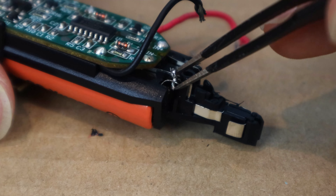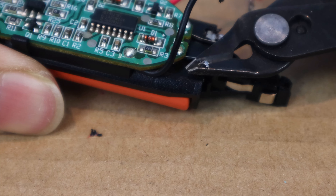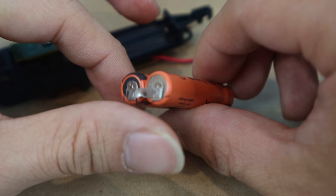If you haven't fully removed the wires from the tabs, you can go ahead and bend those tabs up and snip the tips off. On the other side, the batteries are adhered in the bay using double-sided tape, so you can gently pry and lift them up. Here are the two tabs that I snipped the tips off of. That's the double-sided tape on the bottom, and at the other end, there's a soldered tab connecting them in series.